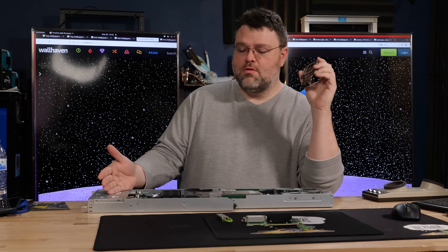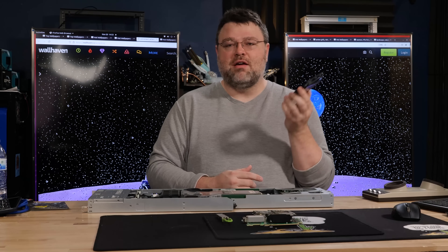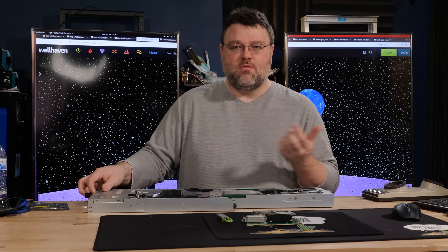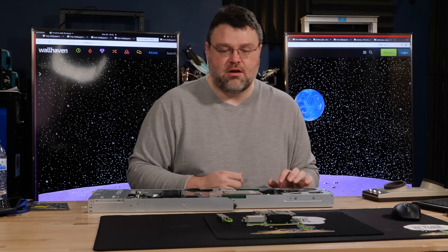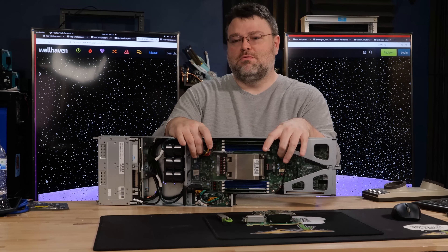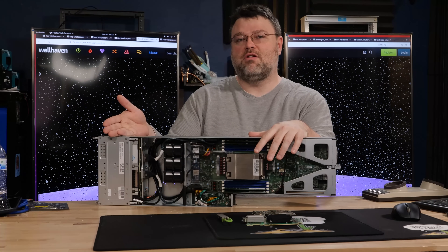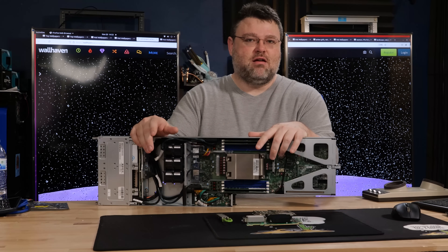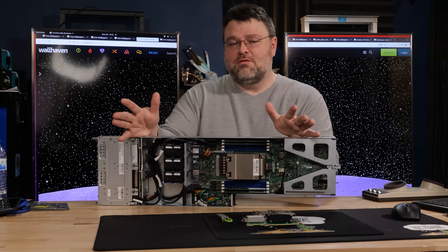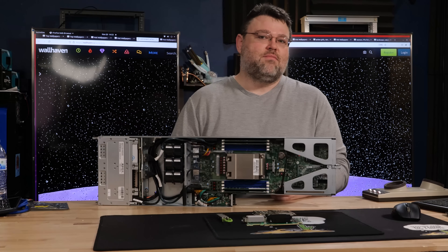So you're running your server workload, it's self-contained. We've got four 4-terabyte U.2 drives. These are available in up to 16-terabyte capacities — four NVMe interfaces on the front. We're doing pretty good with our PCI Express lanes, even though the platform has 128 PCI Express lanes. I've also got an Optane M.2 cache right here and my operating system M.2 is back here. So we get dual M.2 slots plus U.2, plus there are also four SATA connections. If you'd rather run four SATA drives up front you could, or you could use a proprietary breakout cable and run some SATA disk-on-module if you really wanted to. I don't know that that's a supported configuration from Tyan, but you do have the SATA interface as well as NVMe, so you could rock SATA up front if you really had to.